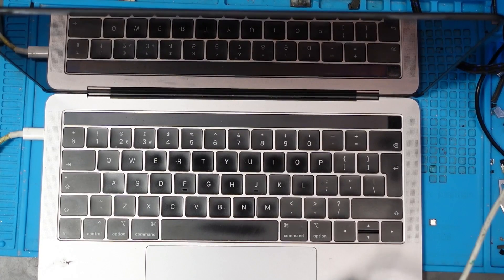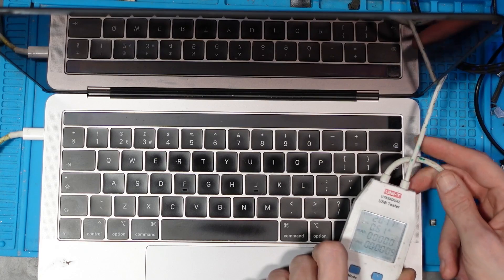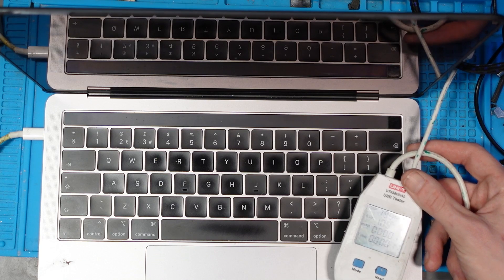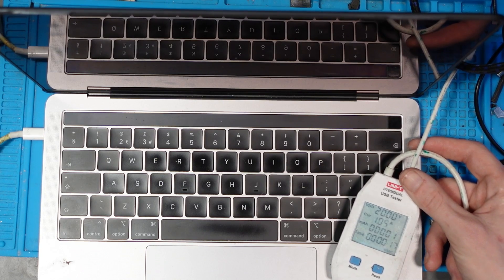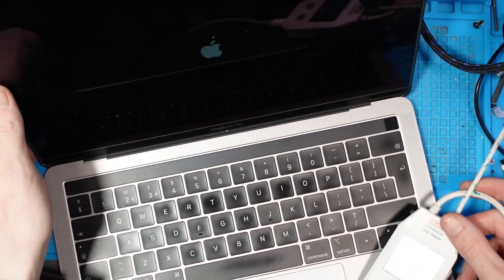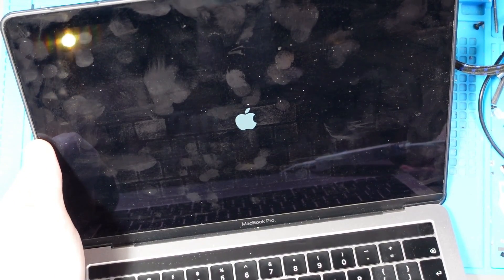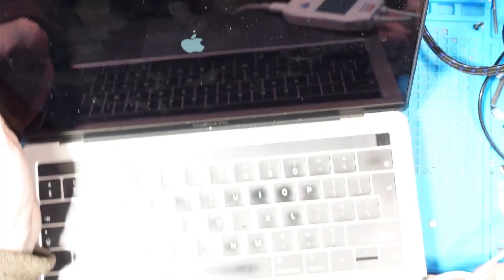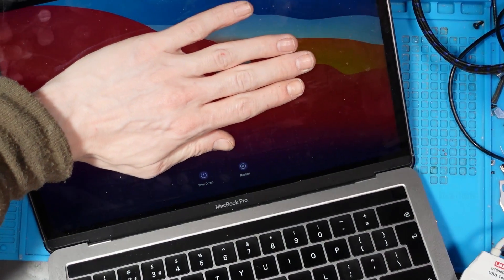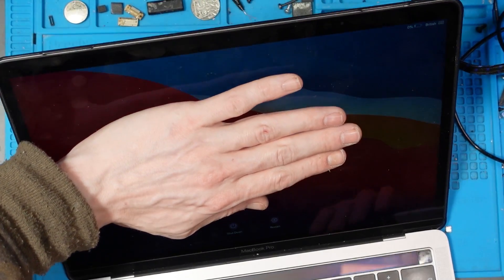We should be booting up - the battery is probably completely dead. 20 volts, half an amp, 0.6, 0.8 - there we go, boom, we are charging. There's that chime I'm looking for, and there's the Apple logo. Absolutely fantastic - one simple capacitor and I didn't even need to take the board out of the case. It has booted. Easiest repair I think I've ever had to do. I do need to give it a full test and get the customer's password for that.